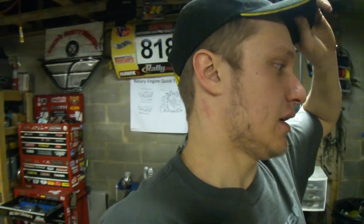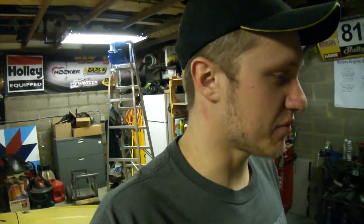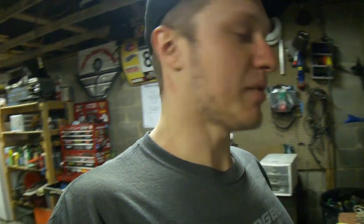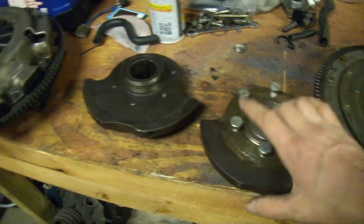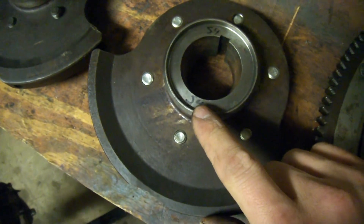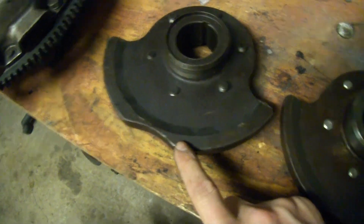If you want to run an RX-8 trans on your 12A, it bolts right up to the back of the motor — no problem, like this car behind me. That's actually the reason we're doing this video. On automatics, there's a counterweight on the back instead of a big flywheel — it's one piece with your big two-and-one-eighth inch or 54mm nut, with a flat flex plate the torque converter bolts to. Each series has its own counterweight — I have one marked Series 4 and one marked Series 3.